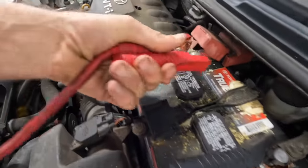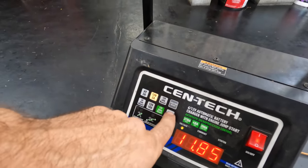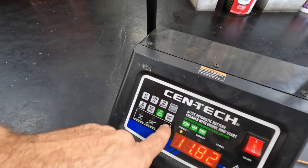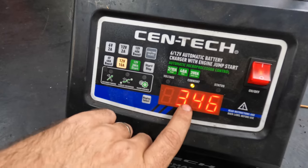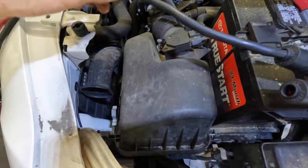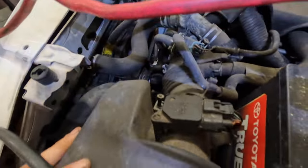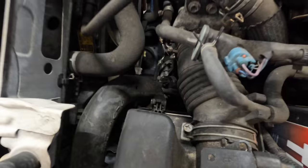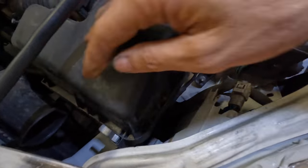The plan here will be to charge this battery and then test it, see if it's any good. There we go - 11 volts. Let's charge it a bunch. How about 12 volt, 10 amp? Begin charging now. It's feeding it some amps - two, three, four, good. While this battery was charging, I did an inspection and found a deficiency: somebody replaced the engine air filter but forgot to put the lid back on. I'll finish that job right now - you push the little clip things down and clip it on. Operation complete.